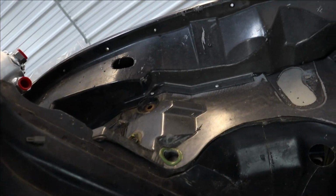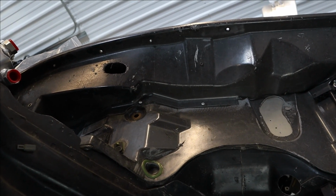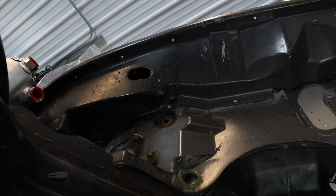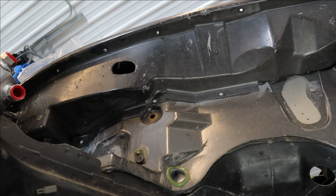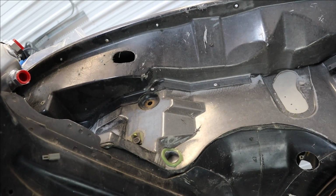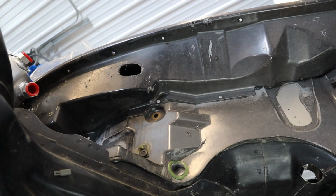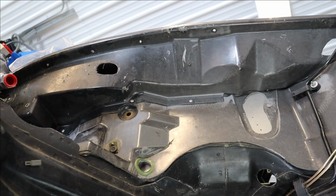I'm aware that the pressure sensor is going to be downstream from the ABS, so when I'm getting into ABS, it might cause my brake lights to flicker. I don't know that for sure, but in a way that seems like a cool idea. So I'm going to try it that way, and if it flickers, it might be cool, because then the people behind me will know, okay, he's trying to really stop. And if it doesn't, if it's just regular brake lights, then that's fine too. But we'll find out.